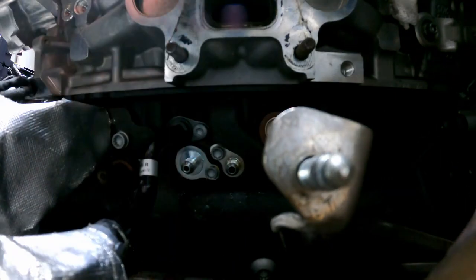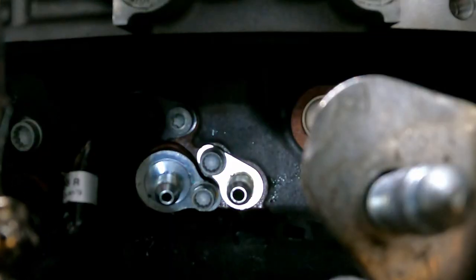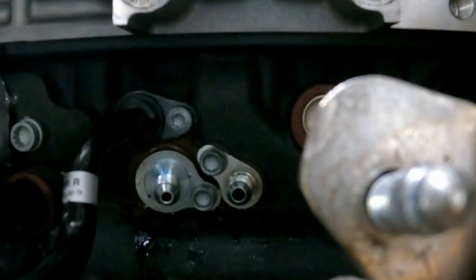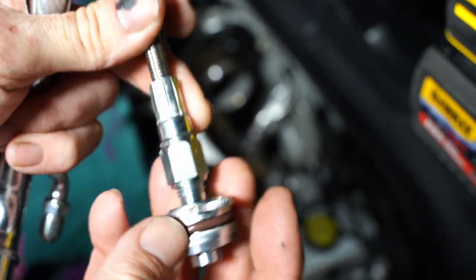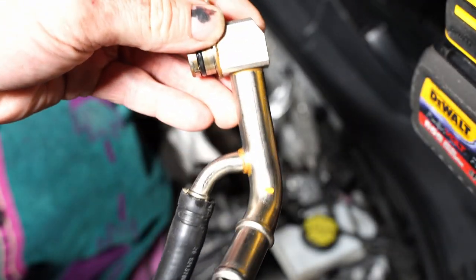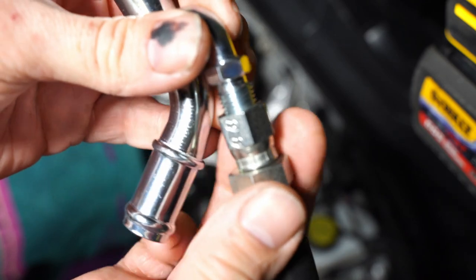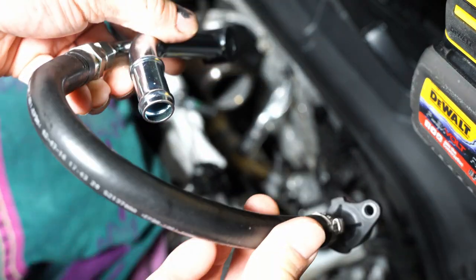This is the coolant return line, and this gave me some grief. There's a replacement metal fitting that, as you can see here, isn't fitting in properly - the O-ring is squirting out the top. That's because when I tighten it down, it's going in at an angle. It turns out I measured this and it's just a fraction of a millimeter too big in circumference. So I need to find a way to connect it to the Y pipe that comes with the turbo, which required going to a hose and fitting company to get the right fitting.